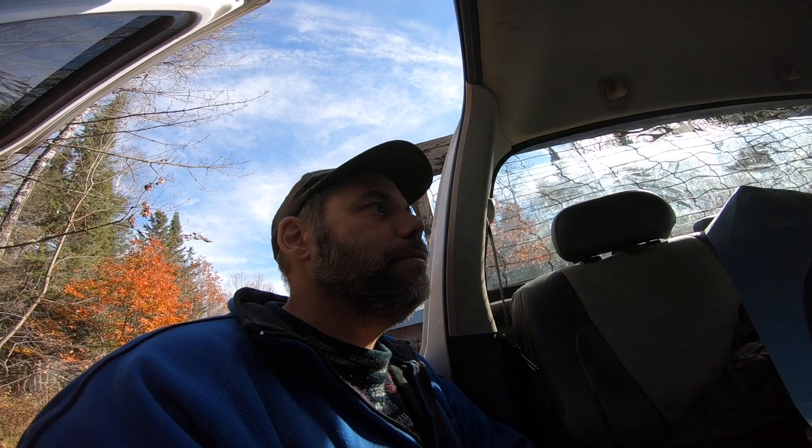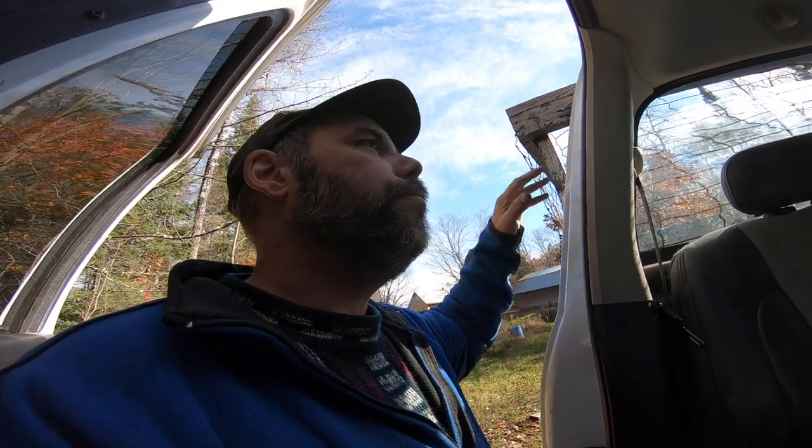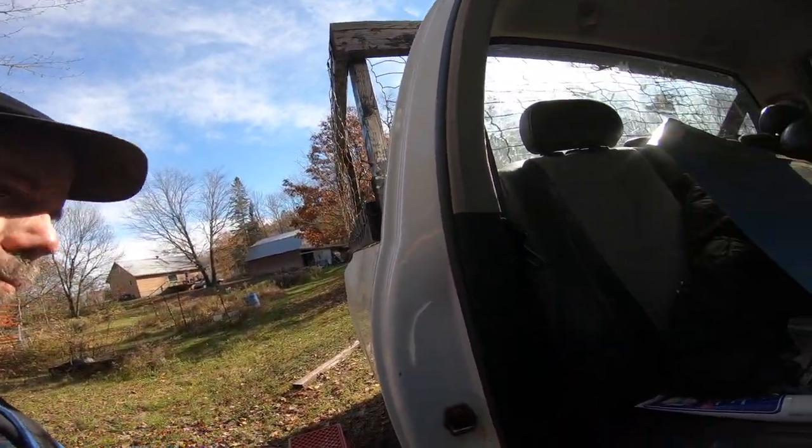I may have a parasitic drain in this truck — probably the headlamp, but I'll test that later. I pulled the battery out because I left it about a week and came back to start it and it was nearly stone dead — charged back to 11.5 volts, so the battery isn't the newest either. What I'm gonna do is drive one battery for a month, pull it out, put the other battery in and drive it for a month — that way it keeps your batteries from dying. I'll get the rotors on, clean up, and go from there.